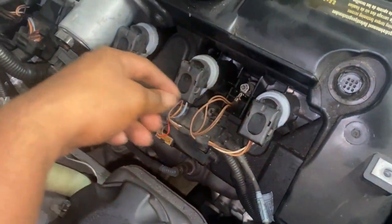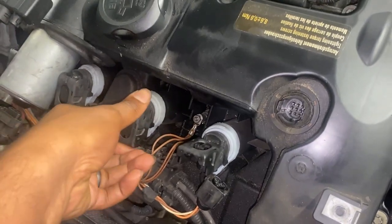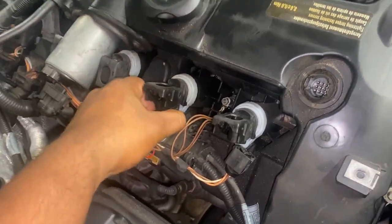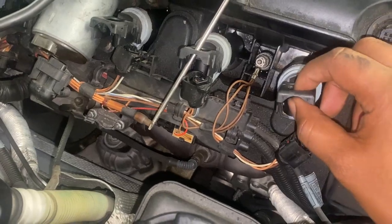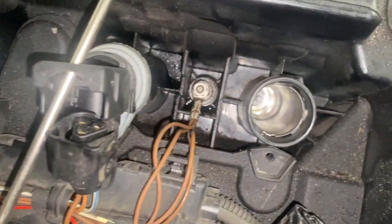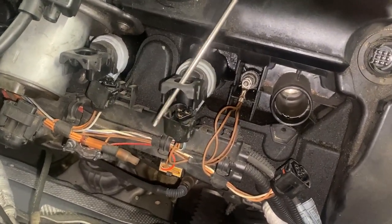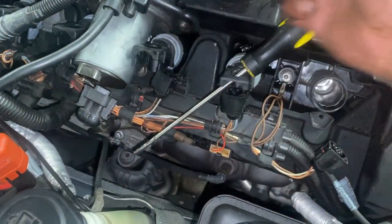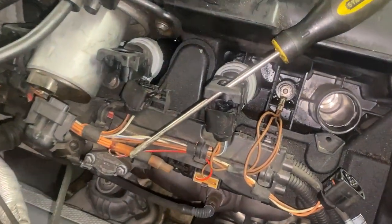Then we're going to go through each coil — pop it up and pull each piece off. Make sure when you pull it off, pull it tight and lift so that it pushes the connector all the way out easily. With all the connectors off, go ahead and pull the coil packs out. What I do is take a screwdriver and stick it through, then use both hands on each side giving even pressure and pull up. I like to give it even pressure so it doesn't break the tabs.